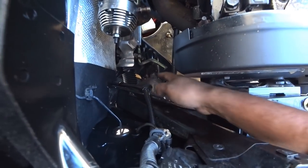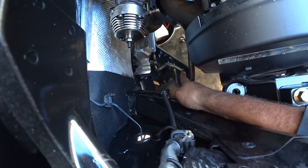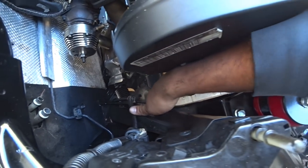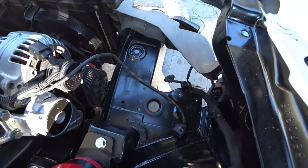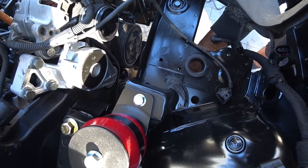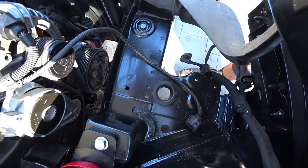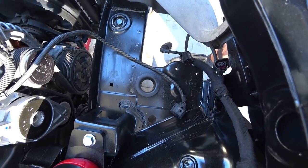Down here you'll see — I cut the power steering return line right here. We're going to be using a hose that goes over this, bend it down a bit, route it down below the frame, and bring it over to here. That power steering hose has to go all the way down and then we're going to run another line from there to the actual pump itself. That's pretty much the basics of it.